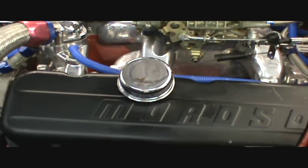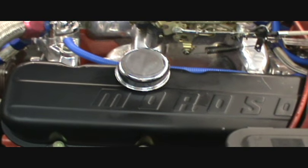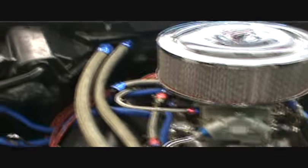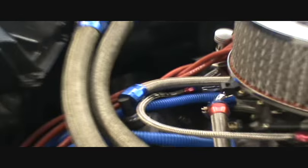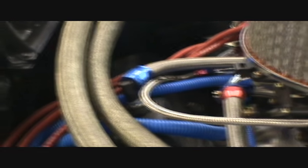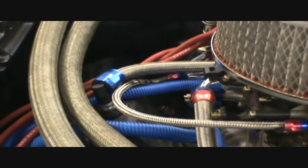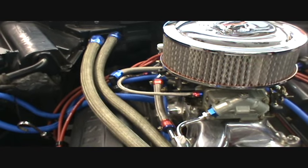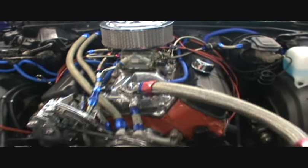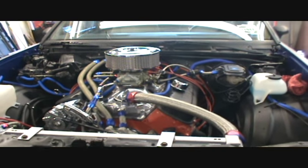That's a quick tip for guys who have a lot of issues with oil coming out of their breather — that just helps keep it out. But always run a PCV valve. As you can see, I've got a PCV valve right there running straight to the intake, fully ported, so that helps keep everything at negative pressure inside the engine so you're not pushing out gaskets. Keep checking back as I keep working on the engine and I'll keep giving you updates.